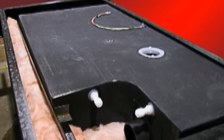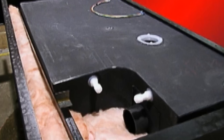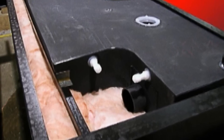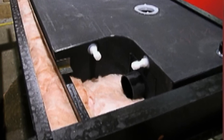This is the ideal situation: an insulated compartment for a black tank that fits up underneath a cutaway chassis — not a van chassis. You can see the tank itself is protected, there's insulation in there, and you're going to have very few problems with this tank freezing. A lot of times they also duct some heat from the heater down here as well, so as long as you've got the coach heater on, these tanks receive some of that heat. This is really hard to find on a Class B, but it is kind of available.